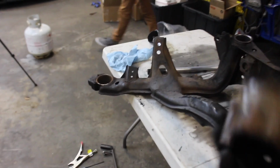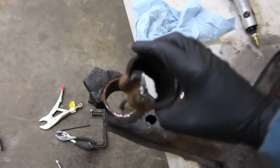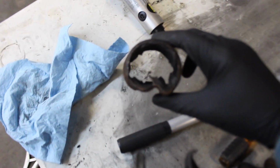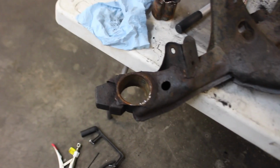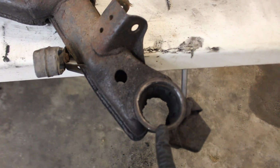But we're out here, finally, after hours, this front sleeve is out. As you can see, she went in there, and I did some carnage. So I basically crammed a flathead in and started hammering it down, and that gave me that little dip right there. And then I started peeling up around it, and eventually I was able to just pop it out from the bottom. So that's awesome. Still have to do this side, so we're about halfway there.